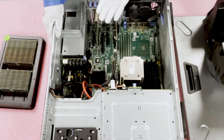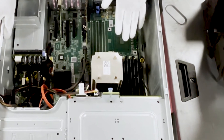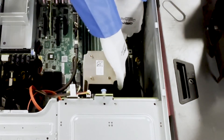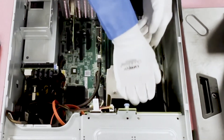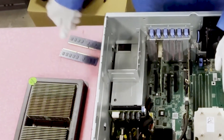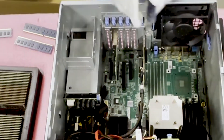Right now the system has six 2GB sticks — so it's a pretty weak 12GB system — and we're going to put in 32GB sticks and take it all the way up to 192GB. When removing modules, always put your fingers on top so they don't fly up when you click the tab. With 2GB sticks we're not too concerned, but with a 16GB module you definitely don't want it flying up and damaging anything of value.